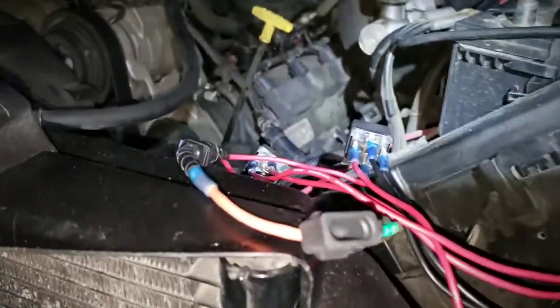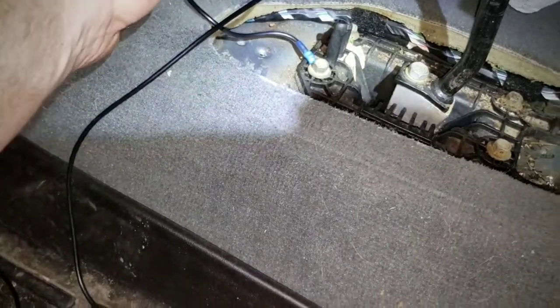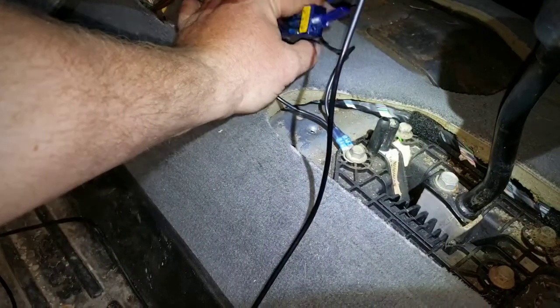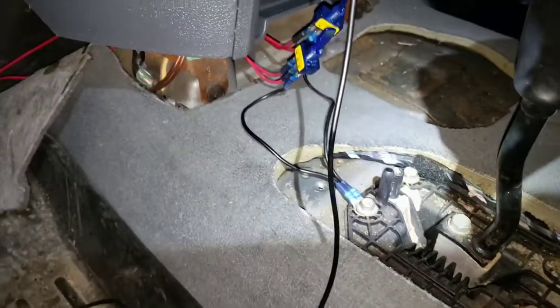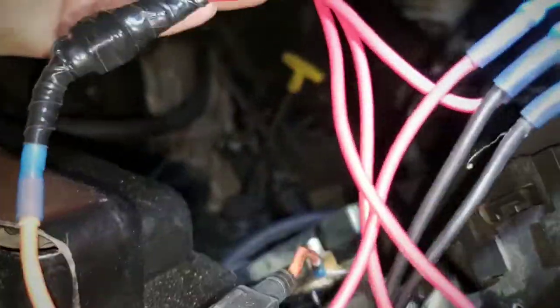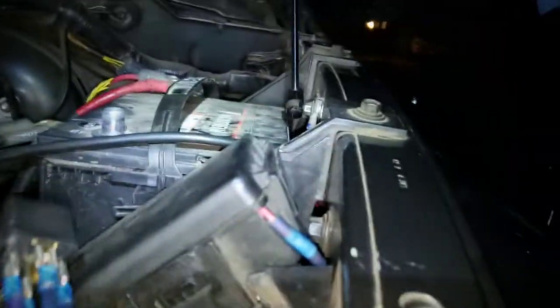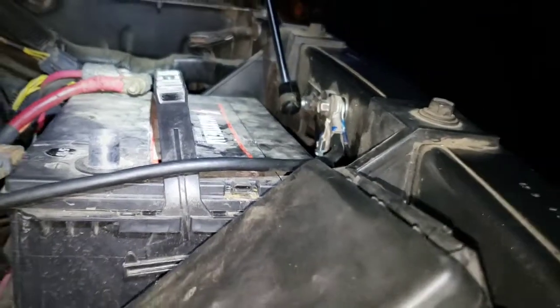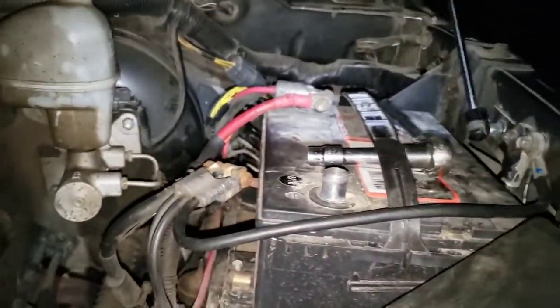After this I'll cut it and wire it into the switch. Next I'll be wiring up the ground for the indicator light — take that and run it to the bolt. Now I've got the ground wire going from the switch to the bolt. I only have one more thing to do. Last thing, run a ground from pin 85 to that brown ground connection. Everything should be hooked up properly — ground to the ground post — and now I'm going to hook up my battery and test my switches.